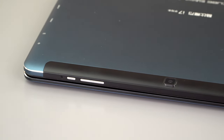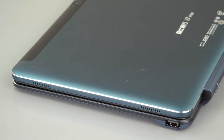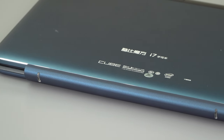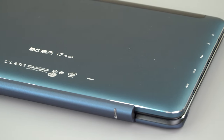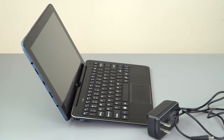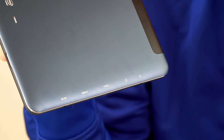The stereo speakers are very anemic, which is forgivable at this size and price. There's a 5-megapixel rear and 2-megapixel front camera, both of mediocre quality. Wi-Fi is Intel 3165 AC dual-band with Bluetooth — Intel's lower-end offering, but it worked fine. The battery is 4300 mAh, with a compact charger. For art use, I averaged six to seven hours; for note-taking at reduced brightness, you could likely get through a full school day.